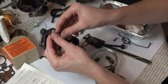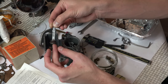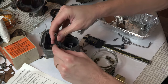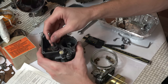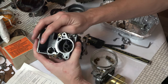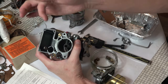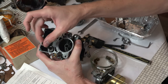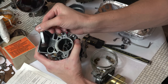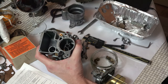What else do we have? This one here looks pretty good — this is what the Carter Master Rebuild Kit ones come looking like. But you can see it's even all the way round and might be a bit too much. I can't even get it to go in. There we go — see this one? This one is too tight. It's getting jammed, so the plunger wouldn't return when you pulled off the throttle. So this is a really good demonstration: one is too little, one is too much, and we've got ones which are just right.